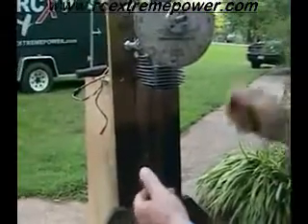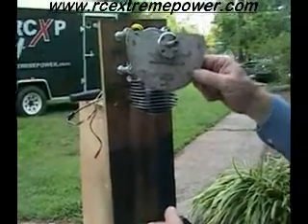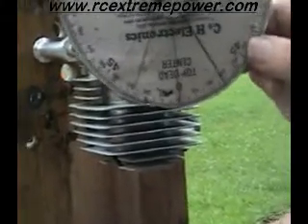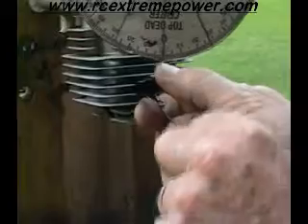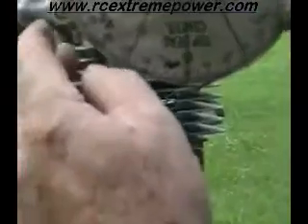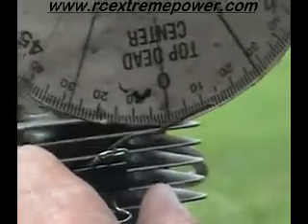The way that I do it — I generally do it with a plug in, but to save time I'm going to do it without the plug. I use top dead center rock. All engines — most engines — have 10 to 12 degrees of top dead center rock in them. Here's a clip. It's just a simple paper clip with a wire solder on it that you can clip on one of your fins, and it will hold it in place. I set it up here and figure out where my rock is — right here we've got right at 10 degrees rock.